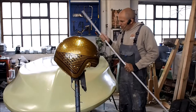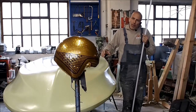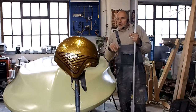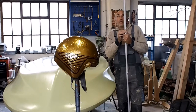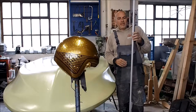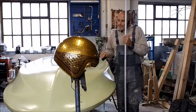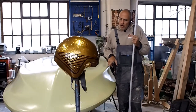As you can see, I have this PVC pipe that, before I flip it back, will go on the inside in the bow part underneath the deck. Cables can be routed through this, because especially in these narrow boats, if you put your feet in, you sometimes get entangled in cables hanging down and then you rip them off, which is obviously something I want to avoid. So I'll take a heat gun and bend this into an S curve that follows the deck, and then I'll laminate it in with a couple of stripes of fiberglass. I'll show you in a minute. We also put the tank filling funnel in, laminated it in, so I'll show you that, but then I have to take the camera and go underneath.